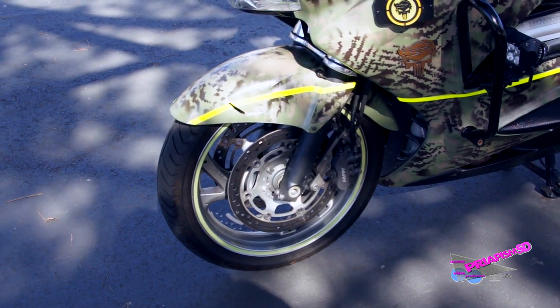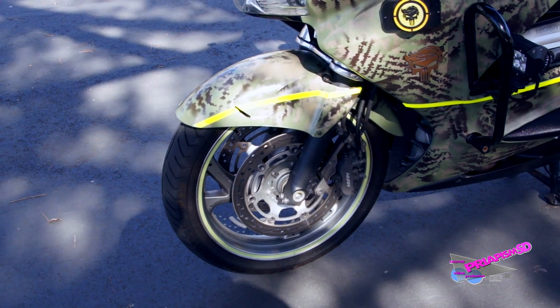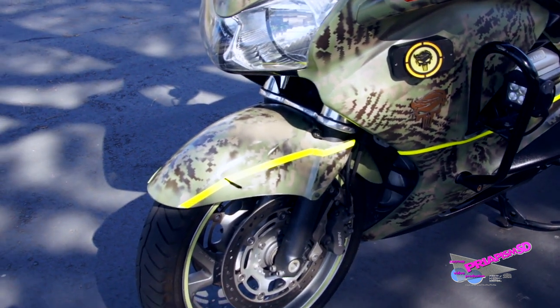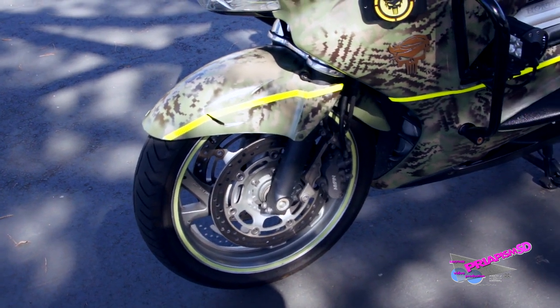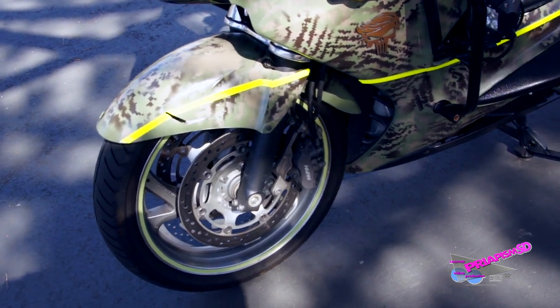The front of the bike was definitely a bit too light. I went to the Racetech website and found a heavier set of springs, which definitely makes the front end track more securely. I also added a front aluminum fork brace, which gives more stability in rain ruts on the freeway. Without these modifications, there was a bit of a weave at about 80 miles an hour on the freeway. These definitely cleared that up and add much more stability.